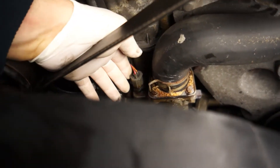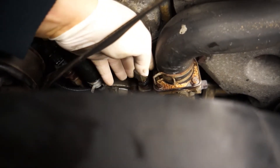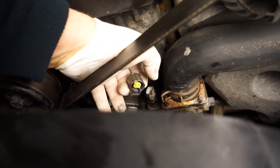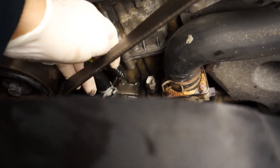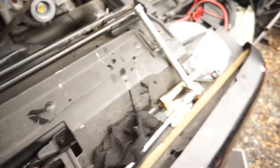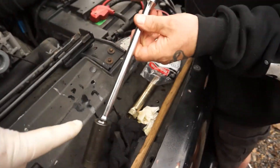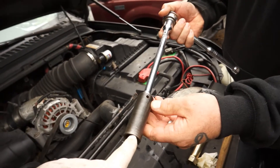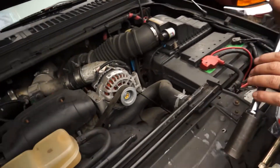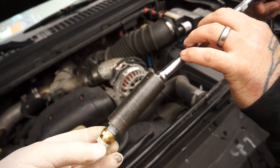We're just going to push the little quick connect — it's got a little clip on the side. Push that and pull it off at the same time, and there are your two prongs that match our plug. We'll tuck that up out of the way so June can get down in there with the socket. He's got a half-inch drive with about a 12-inch extension and a 19-millimeter deep socket, and that fits right in there perfectly, leaving the threads out.